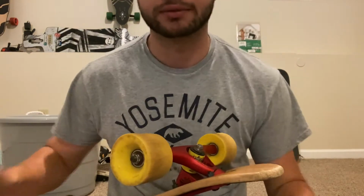It's right on there. Bing. What that does is, it is called a no-slop washer. So, basically, sometimes you feel unstable and it's simply because the bushing has too much play. The washer with the inserted little plug will stop the slop, hence the name slop stopper. So, crank that, pop it down. Don't be afraid to go a little bit tighter than you usually do. Boom, we got it. All right.